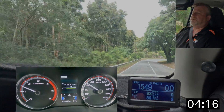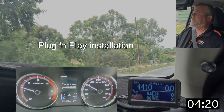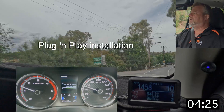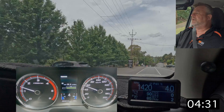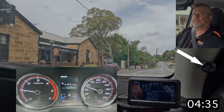The kit is fully plug-and-play. You basically just have to remove some trim to get to a connector which is in front of the shift lever, unplug the factory connector and plug our harness in there, and then it plugs onto the OBD2 connector — that gives the Automate Sport computer power and data — and then there's the LED switch on the A-pillar.